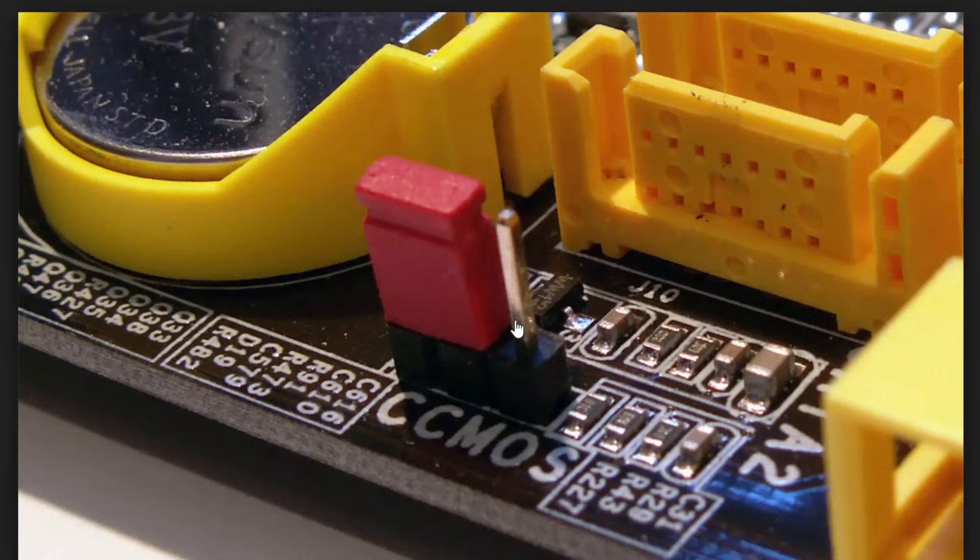When we configure our BIOS, it is stored in a non-volatile location — they reserve some memory on the motherboard, usually in the chipset. The lithium battery on your motherboard actually keeps a small amount of voltage on that NVRAM, keeping it from losing your BIOS configurations. This is also a clear CMOS jumper — it has pins and a jumper tab, and you follow the motherboard manual procedure to sequentially reset it.